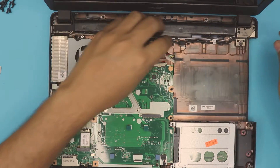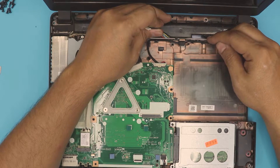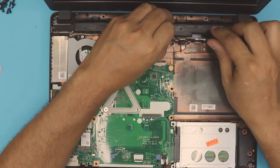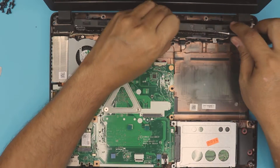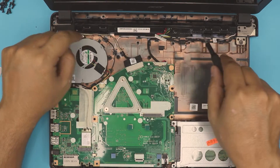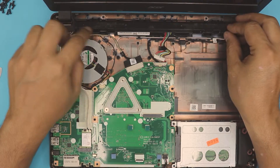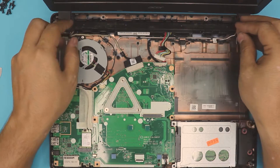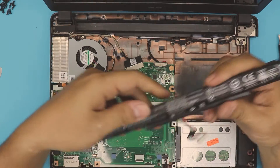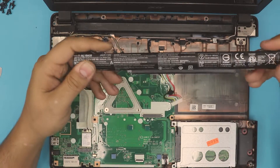Untangle the cable, then to lift it up there are tiny hinges right here — you need to pull these hinges backward. There's one right there and one right there. So there's one, two, three, four. Once you remove those, the battery comes out. If it doesn't, just pull the triggers backward — and there's your battery.